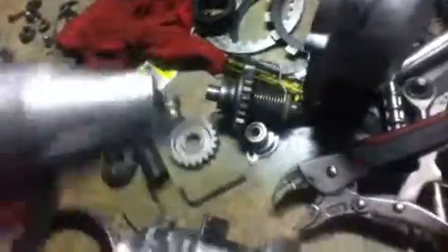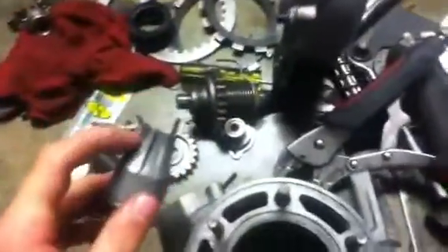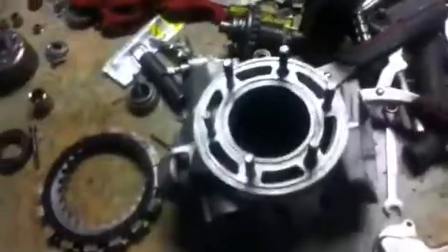So what I'm going to do is take a thick wire brush after grinding that down just a little bit more — it's a real fine grinding stone. I'm going to take a wire brush and make that all smooth so it'll look like a machined part. It doesn't necessarily need to be machined to do this; you can get away with just a grinding mod, it's much cheaper and has the same effect. Just do it right and carefully — make sure you grind the right side.